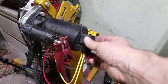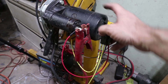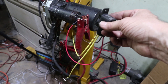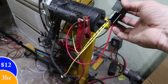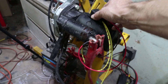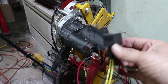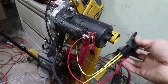One idea to mount this relay would be to put it on a bracket from these two screws and attach it back here. The starter does get warm, so it might also be a good idea to move it a little further away — maybe mount it to the body or some kind of hanger off the bottom of the car. You don't want it to get wet, so protect it from damage. Probably the worst place to put it would be up on top — that's going to get a lot of heat from the starter motor and potentially the transaxle conducting heat into it. So I think I'll put it somewhere near here. You want the wires to be short, but you also want it to be protected.